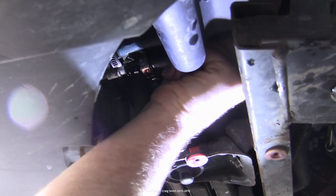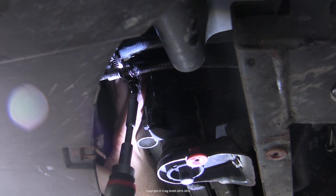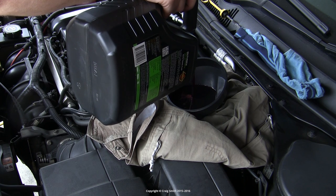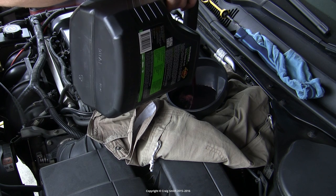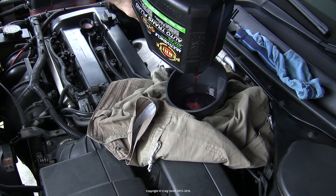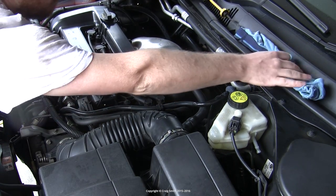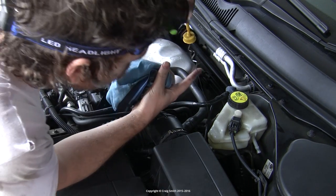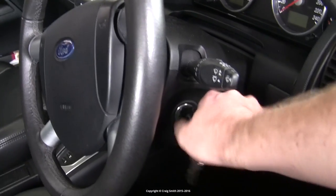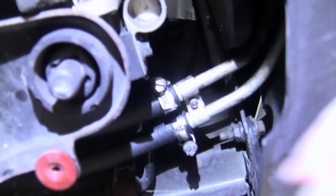Just so you understand what's going on: the oil sump which we just refilled a minute ago will now have been depleted once again. So this is where we go and add the rest of our new oil. Once we've done that, we will have drained eight litres of old oil and added eight litres of new oil. That's not a 100% replacement of the transmission's oil — it's closer to two-thirds or maybe three-quarters — but that's pretty good, and it's all we can do without using a professional transmission flushing machine. Once you're done adding oil, remove the funnel and replace the dipstick, making sure it's as clean as you can make it. At this point, start the engine again and let it run for a few minutes to warm up. Take the opportunity to jump back under the car and inspect everything for any leaks — the oil cooler hose that you disconnected and obviously the drain plug — check that there are no leaks.